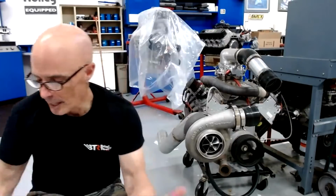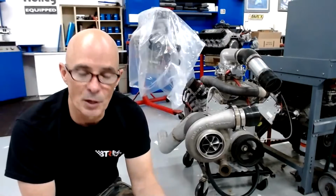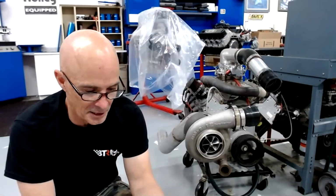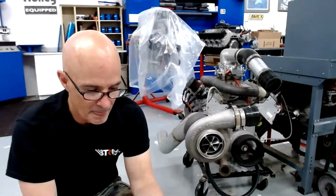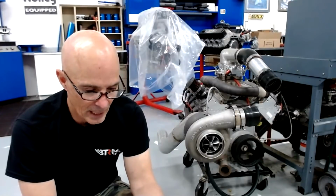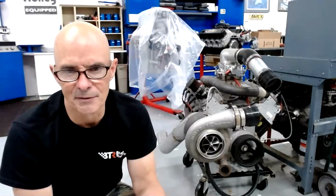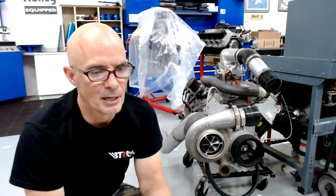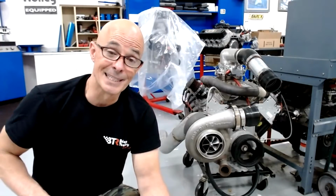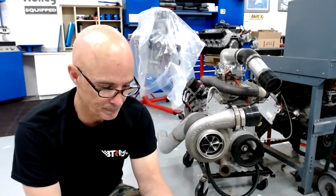Yeah, Julius, I actually thought about that. I'll show you guys a photo of the intake manifold. Julius wanted to know if I could make an intake that has a center-mounted throttle body opening and one on the end. We were thinking about that when we were doing this. The other thing I did, one of the tests I wanted to do, and it's really kind of esoteric, is we have radius entries, obviously, in the runners inside the plenum. I'm going to show you a picture of what I'm talking about.